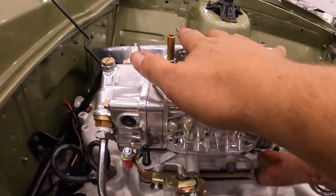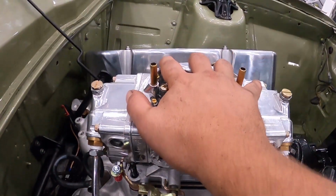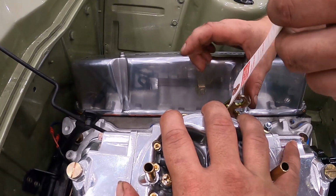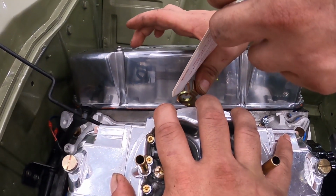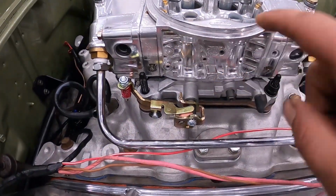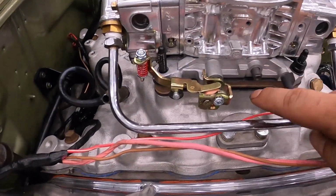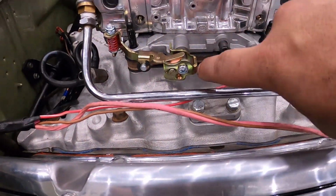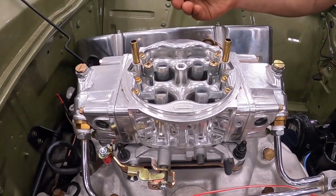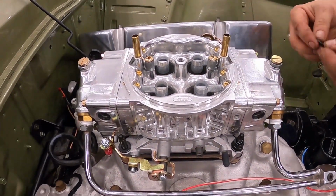Now I'm going to hold it down here. Can you grab that throttle shaft there, bro, and open it? Just make sure there's no obstructions, that it opens wide open, clean, and shuts. Beautiful. Sometimes the Carby can foul on a gasket, on a spacer plate, on the inside of the intake. There's any number of reasons that you can get stuck there and not get full throttle opening.